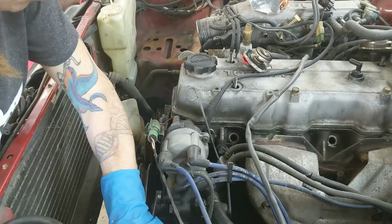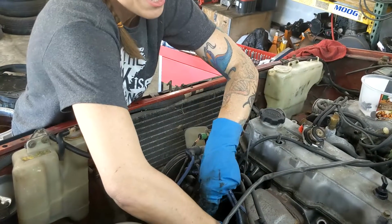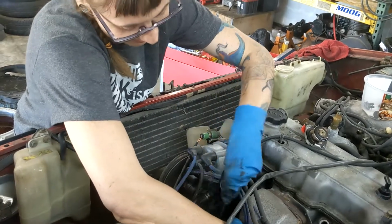Once that power steering belt is pulled out of the way, you can remove the 4 bolts holding the pump to the bracket, 2 in the front tucked kind of behind the pulley, and then 2 in the rear. All that is kind of underneath that distributor, so if need be, pull the cap and wires out of the way to show you the bolts. I forgot how awesome ratcheting wrenches are.